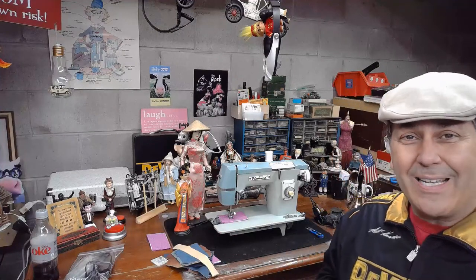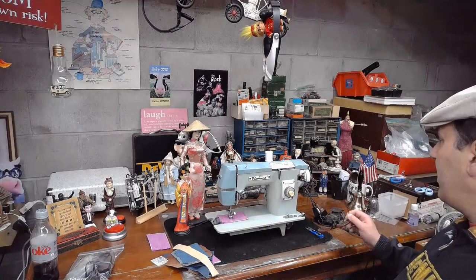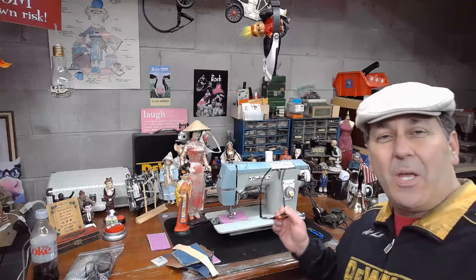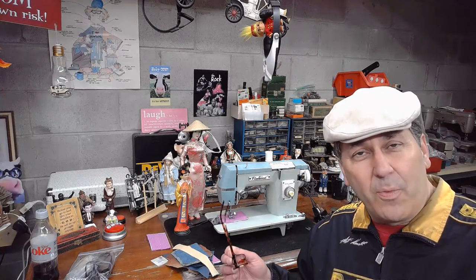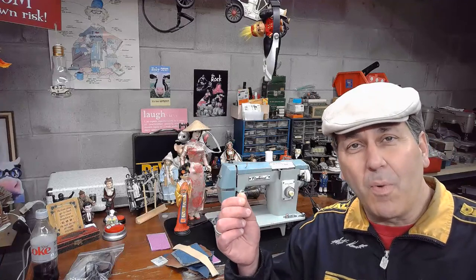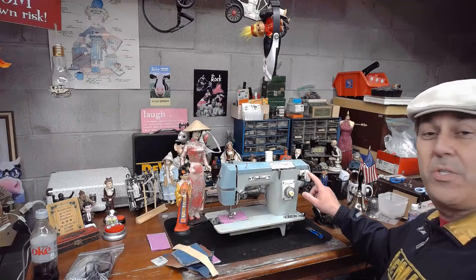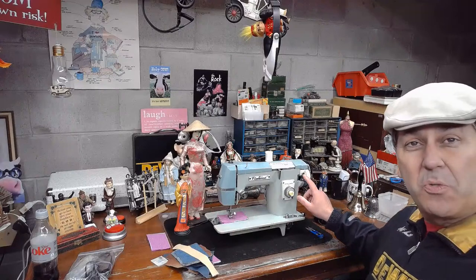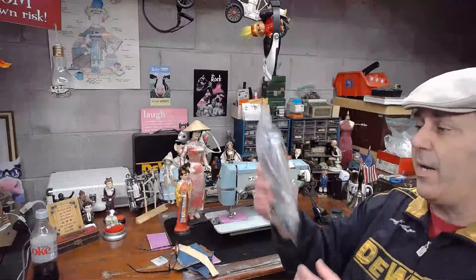And this one, like I said, just needed a number of things. Upper tension was an issue. The motor was an issue. The owner, bless her heart, Pennie Young, because the bobbin winder had been damaged, I don't know if the machine was dropped or what happened, but she literally would take almost like a knitting needle. And right here, you can see this piece was missing on her bobbin assembly. These are some of the parts right here.